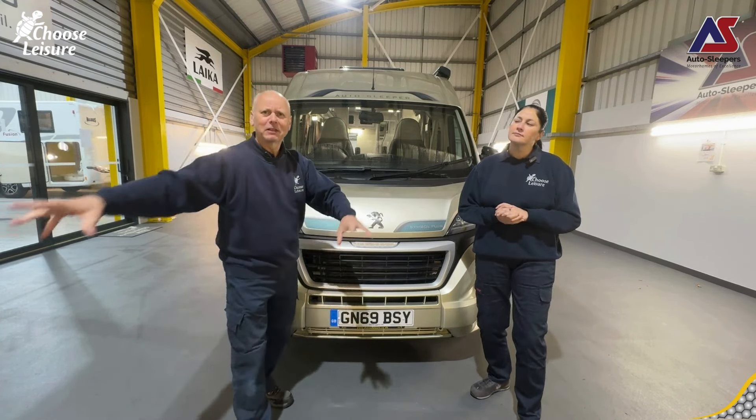Here we are campers on the near side, the passenger side of the United Kingdom. We've just turned up at the campsite, we've got the handbrake on, maybe even want to leave it in gear. First thing we're going to do is locate our drains. No drains on this side, so we're going to walk around the back of the van, open up the rear doors, and I'm looking for the boiler drain. I'm going to open up the cupboard - we find a Truma boiler drain here. I'm going to spin it round, push the button in, and the boiler drain is now closed.